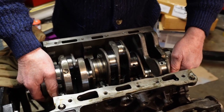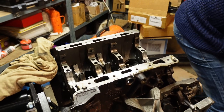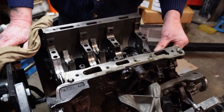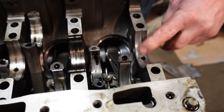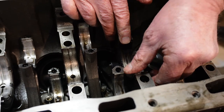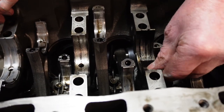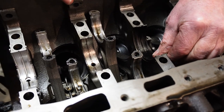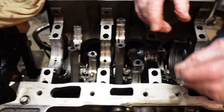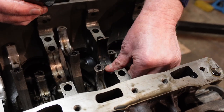I'll take the crankshaft out. Those journals — I'd say that crank's pretty bad. As you can see, the bottom shells have the oil hole and the groove in them to feed the crankshaft. On this one it's completely the reverse — it hasn't got a hole in there, so it's been getting basically no oil. As it spins it's obviously going to pass that hole with the other bearing and get oil at some stage, although it's been slight. That is the shell that should be on the bottom, and that one should be on the top.